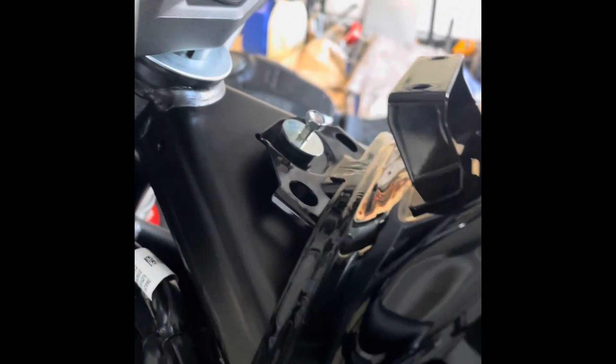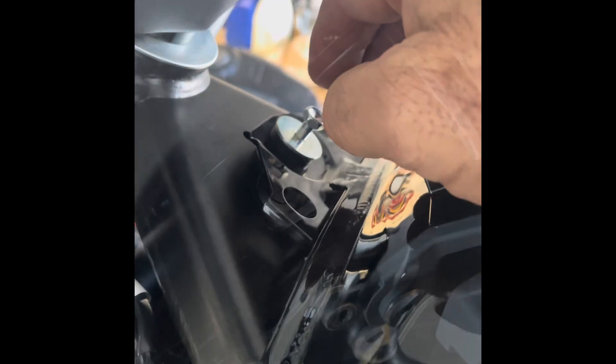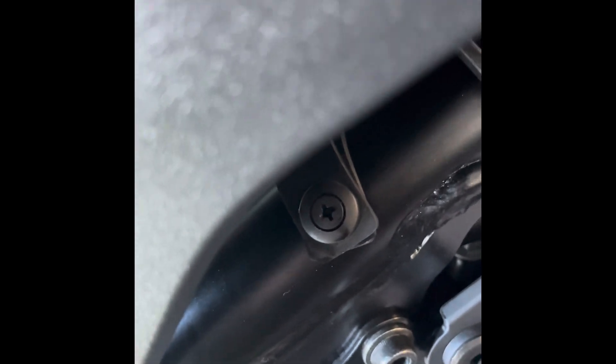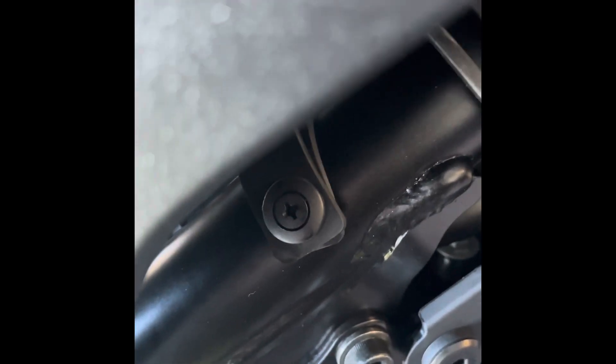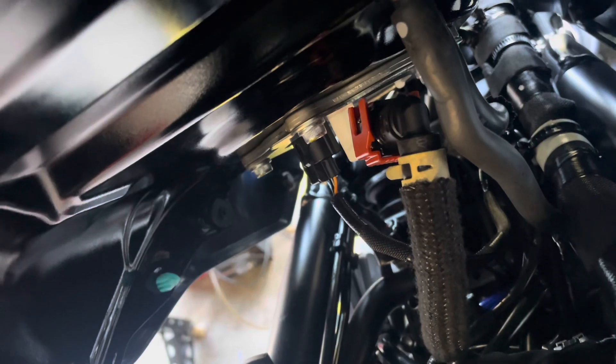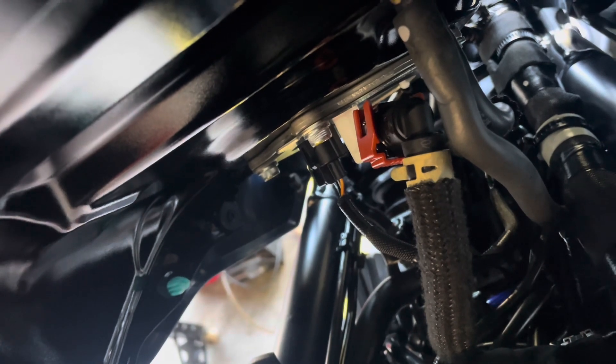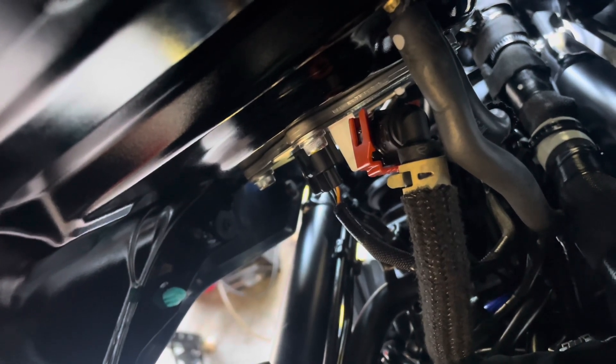With both covers off, we're going to remove the bolt holding the front of the tank down. On the right side of the frame there's a little strap holding everything in place — these can be a pain. Lightly push or spin that center part out and it will come out. Then lift the tank up. You can see the connection for the fuel pump and the fuel line. To remove the fuel line, push the orange clip down away from the body and press the two buttons on each side.